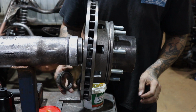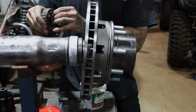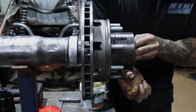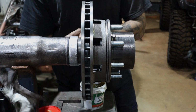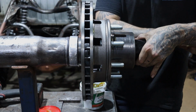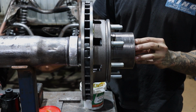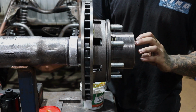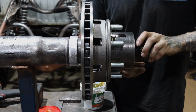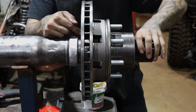And now, that race that we've got, obviously, like I said, it's an old one, but for now, this will set us up by preloading that spindle nut. Chuck it in quickly, just get a little bit of grease around that. Slam that in the front here, and lifting up our hub, like that. Push it in with your fingers. Then that hub socket nut that we've got will actually act as a bit of a press to push this race down a little bit, like so. And then our nut, start it off real nice and slow and just find its starting point. Don't try and cross thread it, and get about 3 to 4 threads in. That's all good. Chuck our spindle hub socket on there, wind it in by hand, and I'll start seating the back side of this now.